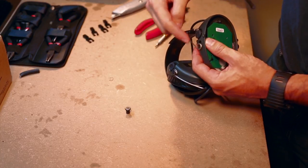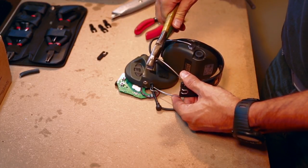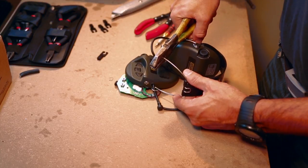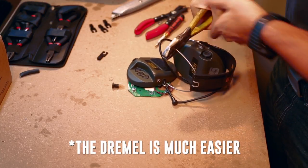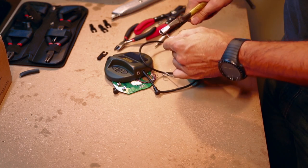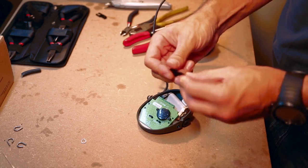You should be able to slide the connection pins out of the headset, which will allow you to fully detach the headset from the ear cups. Now that the headset is removed from the pins, it's time to cut off the ends of the headband wire. This wire is pretty hard, so use either very sharp cutting pliers or a Dremel. Cut the wire immediately above the curl, keeping the cut as flat and clean as possible, then use a small file to remove any sharp edges. Once cut, place the headband aside.